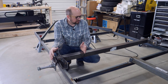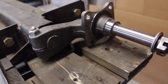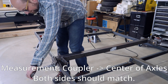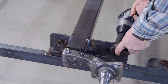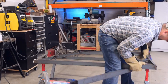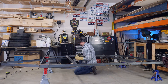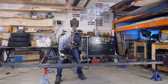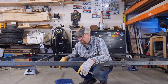On this trailer we're putting an adjustable torsion axle where each side is independent, a nice blend of on-road and off-road capability. It's a custom-made one for us, but it also fits with standard Dexter and Lippert axles. I always like to do this with the axle attached so I know exactly where it's going to be — I'll place the bracket, weld it right there, then pull the axle off. When we flip it over we'll be able to do all the welds on the other side of the brackets. The big thing is to keep the heat moving around so it has a chance to cool between welds, especially on the axle brackets. I have a scale here that goes up to 600 pounds — let's throw this thing on the scale and see what we get.